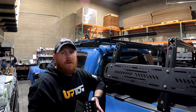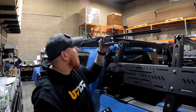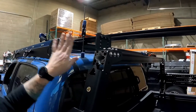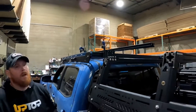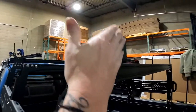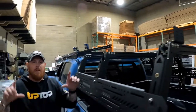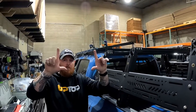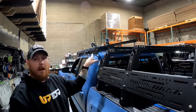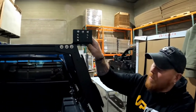All of our EX racks are designed to align with the legs in any given truss system. Take your L-brackets: on the front leg, you want the L-bracket facing the front of the cab of the vehicle. At the rear, you want the big flat part pointed backwards towards the tailgate. So effectively, they should be sitting on the truck making an L — this is the back pointed to the tailgate, this is the front pointed to the cab. I've got the driver's side on, now I'm going to put the passenger side on — it's the same configuration.